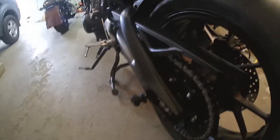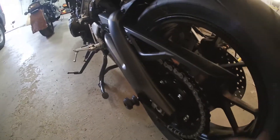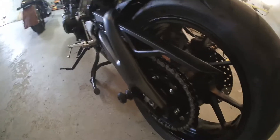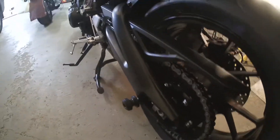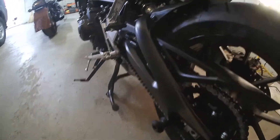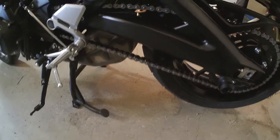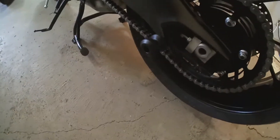So you're not going to wreck your swing arm. A real quick way to write your bike off is frame damage. If you screw up your swing arm, even if you just grind it up really good, that could be enough for someone to basically fail it and say it's no good anymore. So if you're already buying the spools — which are kind of a must-have for working on a bike — I just feel more secure working off of stands than off the belly stand, because the suspension is hung and that's not an accurate way to gauge chain tension. It's definitely something you should invest in.